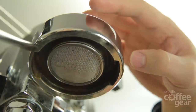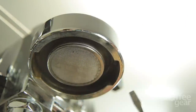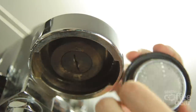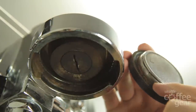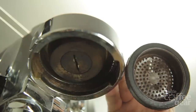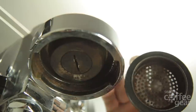I'm coming around on this side to prevent it from buckling, putting my thumb here because it could fall down at any moment. There we go — it's just about free. Wow, you can totally see how dirty this is. We have our gasket and our screen here. Look at all this coffee residue. You can clearly see where the seal was being made with your portafilter, and look at the inside of that screen. I've seen it a lot worse than this, but your pump shouldn't have to struggle through this — this machine was definitely in need of a new screen. It was just a matter of time before this started affecting the pump, so this was a good time to do a tune-up.